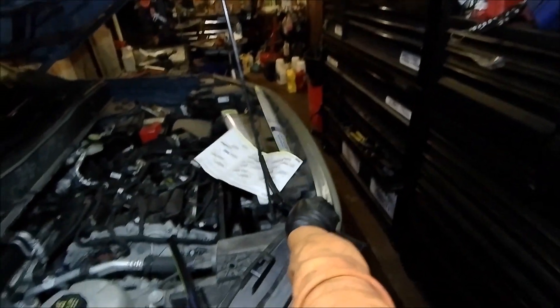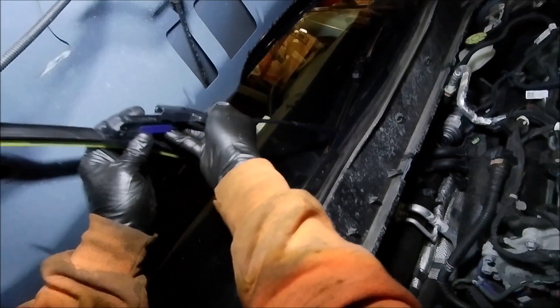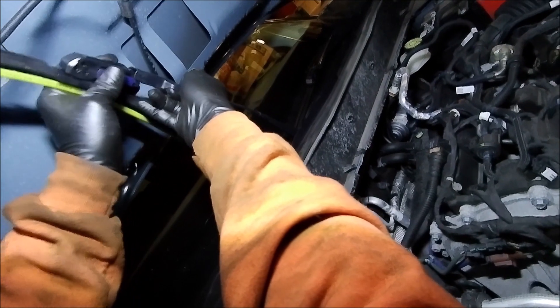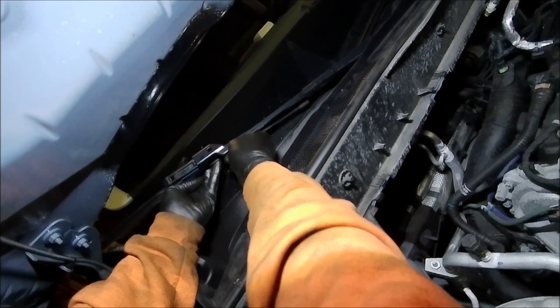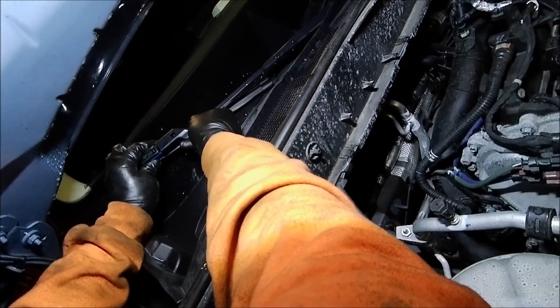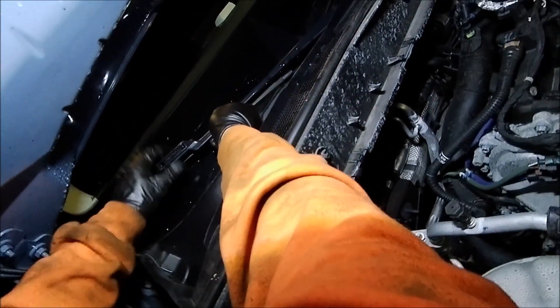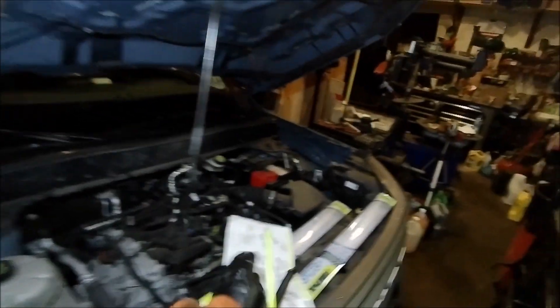Just be careful not to crack your windshield. So that's your old wiper and then your new one. This side is a little bit weirder, trying to get an angle on it. Again, you're sliding kind of like part way through the top. There's no easy way to move the passenger side except like this, so close to the windshield. Make sure both pieces of blue are on the inside. And then just snap that until that piece snaps into place. Then you're going to remove the little yellow protector. And then that wiper is done.